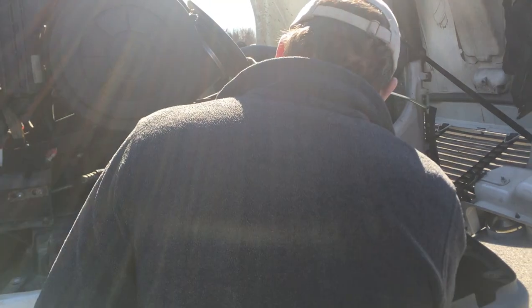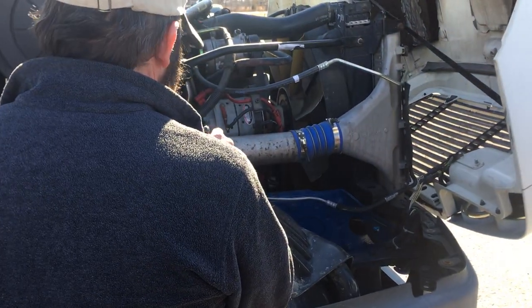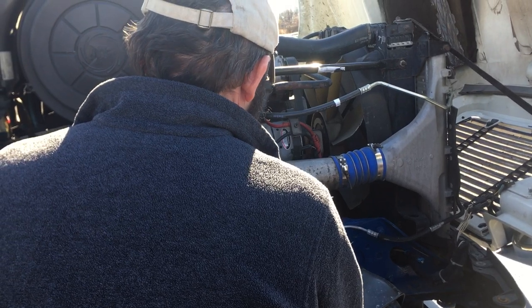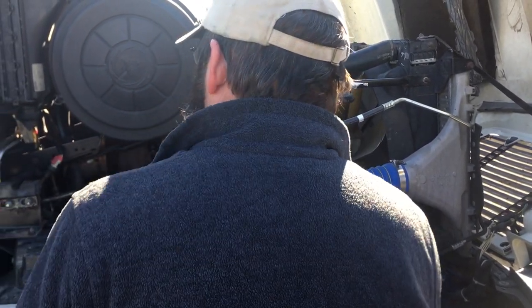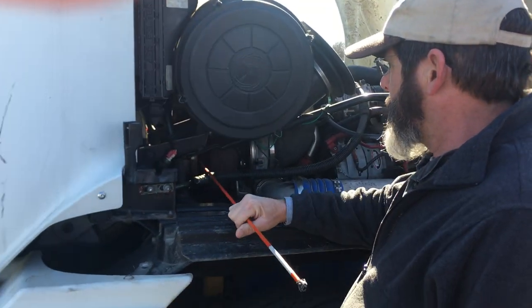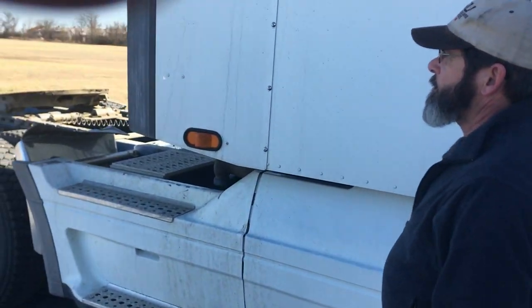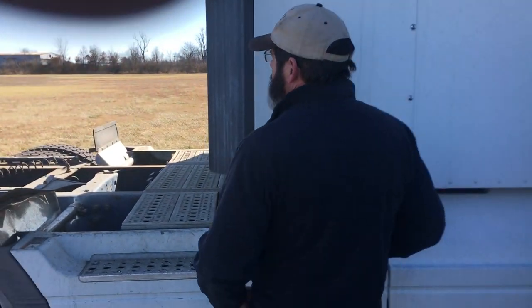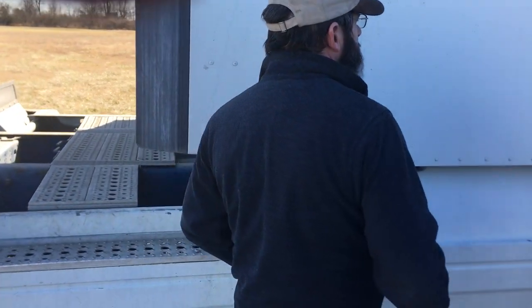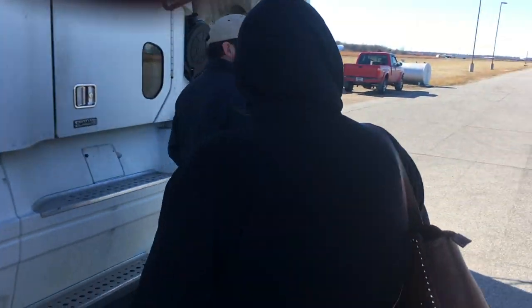Right underneath the alternator is the water pump. You want to know if it's gear driven or belt driven. If it is gear driven, it's securely mounted, not cracked or broke, not leaking any fluid — coolant or antifreeze. Coming back to the exhaust, which runs all the way under the cab and goes up to the muffler mounted on the back — they're all securely mounted, no cracks or breaks. If there were loose connections or holes, there would be black soot, which would indicate a disconnect or hole.